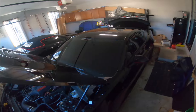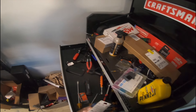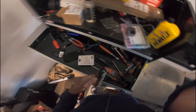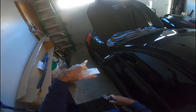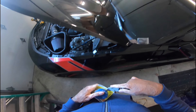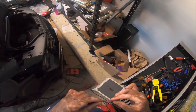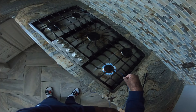Now we got that hooked up. Basically all we gotta do is hook up this wire to that, and then connect this to a screw inside the engine bay to get a ground. So I gotta connect the ground wire to a screw in the engine bay, and connect the positive wire that I ran through the hood right there, through the door. We're about to just test out the switch because everything's pretty much hooked up. These connectors - if you heat them up they should shrink.